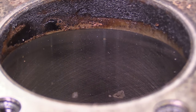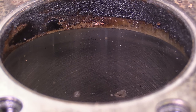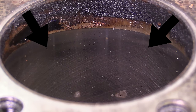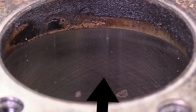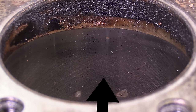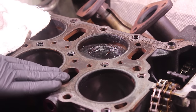This is also a really good opportunity to look at the cross-hatching pattern in the cylinder walls. If you don't see this crossing down in the cylinder walls where the piston rings ride, you are going to either want to send it to the machine shop and have them hone it, or get yourself a hone and hone your own cylinders. After inspecting each one of these cylinders, it seems that the cross-hatching pattern is pretty good on all the cylinders, so I'm not going to send the block out to the machine shop.